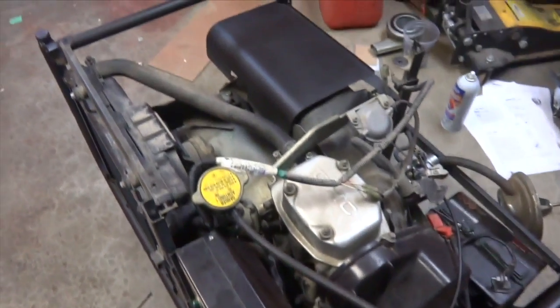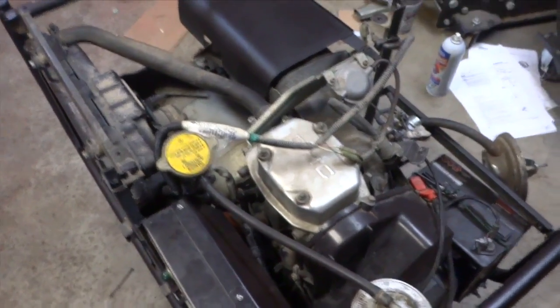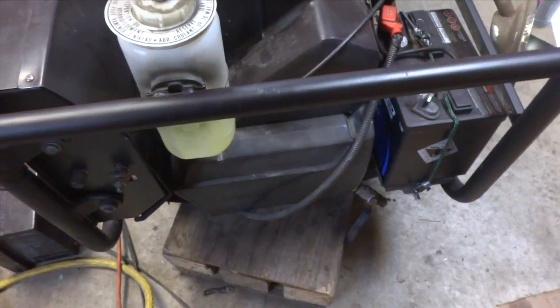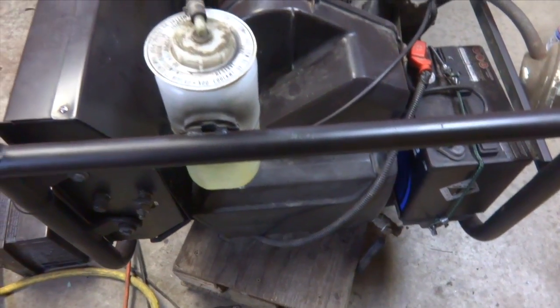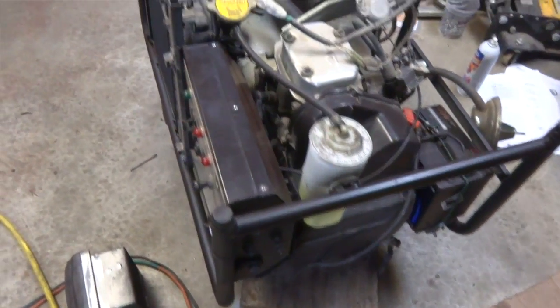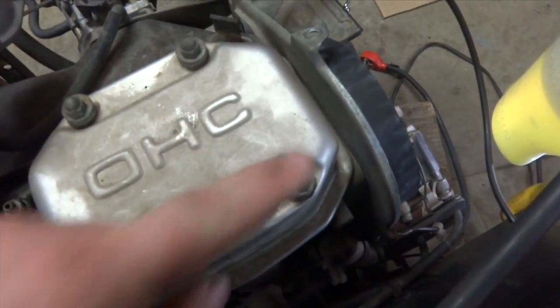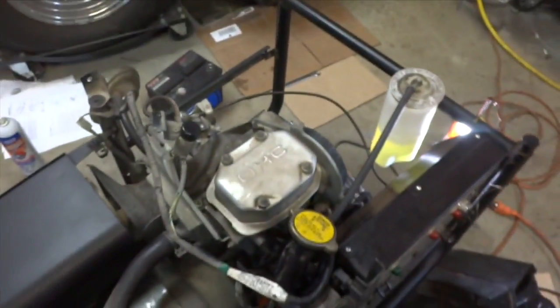I got most of the top guards and everything else stripped off the generator. The valves are going to be underneath this lid — here's the overhead cam. I'm going to remove this side cover here, which is going to expose the flywheel and timing belt, which has the timing marks that we're going to go off of to get TDC. Now that I got the timing belt exposed with timing marks, we're going to remove these four bolts and pull the valve cover off.